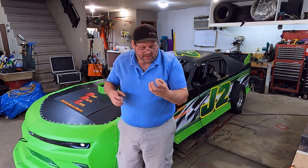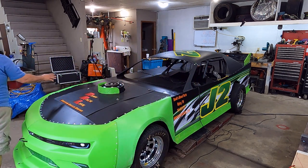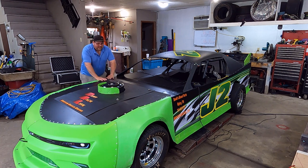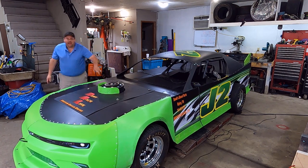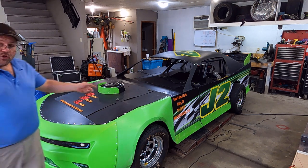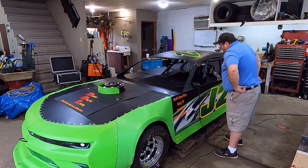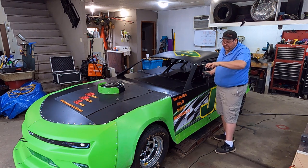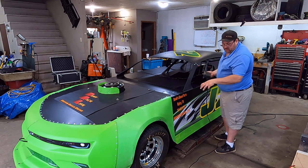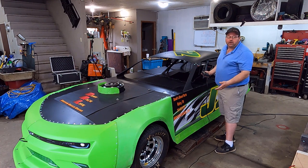All I'm trying to do is make sure the car isn't bound up somewhere — something pinched. I've done this before and seen scale numbers change 30 or 40 pounds on one wheel just by bouncing the car. It doesn't take a lot, but you want everything to settle, because when you set it down it can kind of cup and bite into the scales. That's where a set of floating pads helps — if you can afford them.